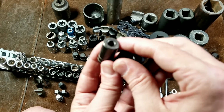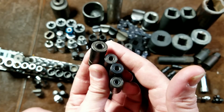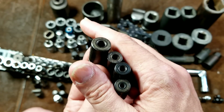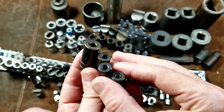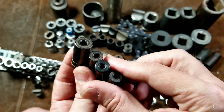And so they make sockets, which oftentimes make it easier to drive a tap, because you can use sliding T-handles, you can use ratchets where you're in tight situations, and it makes running taps quite a bit easier. You can use one of the universal swivels, which helps the tap stay straight. That can be a big deal and prevent you from breaking taps.